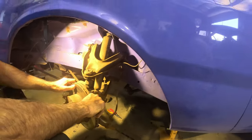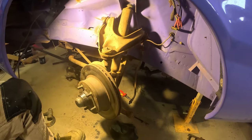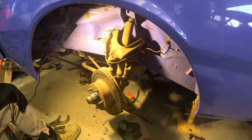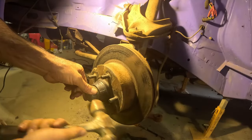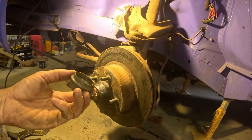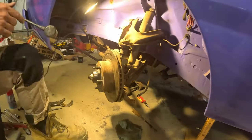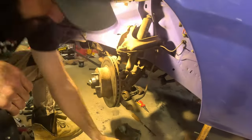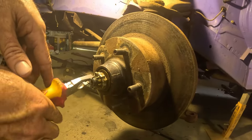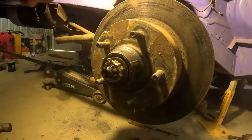Next we need to get the wheel rotor off and the hub. We've got new replacement disc brakes — slotted and drilled. So we'll pop off that cap, which is just hammered off. It's a pretty ordinary looking cap, but it does the job. Next we have a split pin and your bearing. That's why we replace them. Take the split pin out and you've got the bearing adjustment nut.